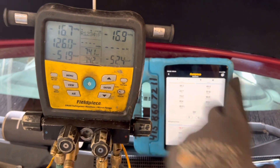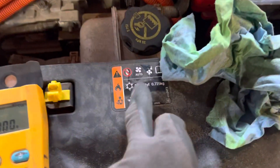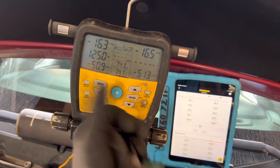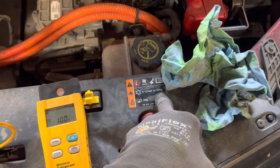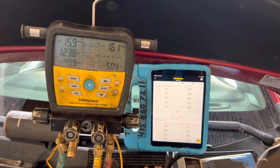You also got to see the dash temperature. So now I'm going to put it under vacuum and completely fill it back up with 725 grams of YF refrigerant. We're going to be able to do a comparison between the first video — what only 100 grams looks like — and then a second video of what 725 grams looks like with the temperatures and pressures. We'll be back in the next video.